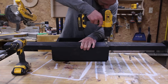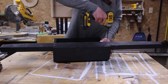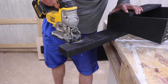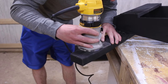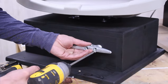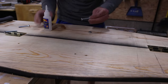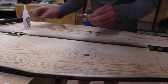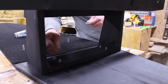Once the paint had dried, I could start piecing everything together. After assembling the motor mount to the support bracket, I added a little notch on the opposite side of where the motor is going to be mounted. This notch will be used so I can have a place to put the rope for the anchor and it won't be rubbing against the side of the kayak. Having the anchor on this side will also help counterbalance the weight of the trolling motor. I also secured a rope cleat to the back of the seat console to secure the anchor rope. I then glued in carriage bolts from the underneath side of the floor, and to make it easier to locate the holes for the carriage bolts, I countersunk each hole.